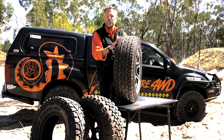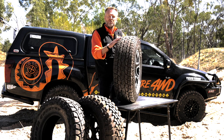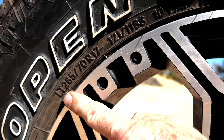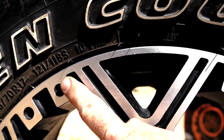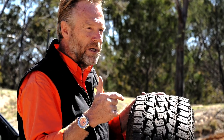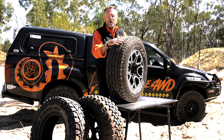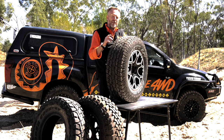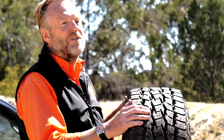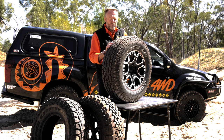There's been plenty of times I've been driving up in the Adelaide Hills during winter and been able to go around corners like the car's a sportscar — I put that largely down to the ability of this tyre to drain water off the road. The carcass of this tyre is really strong. This particular one is an LT 265/70R17 with a 121 load index — that's 1,450 kilograms of carrying capacity. The carcass is as tough as old boots; you won't be putting holes in one of these anytime soon. Toyo's rubber compounds are also compliant, so run in the Australian Outback with the correct pressures, they will not chip or tear.